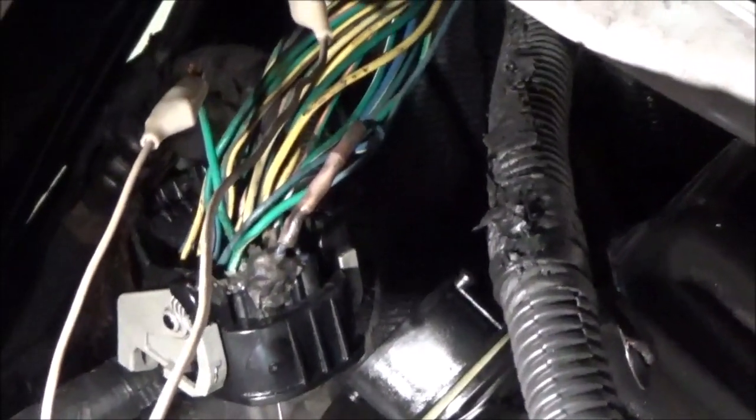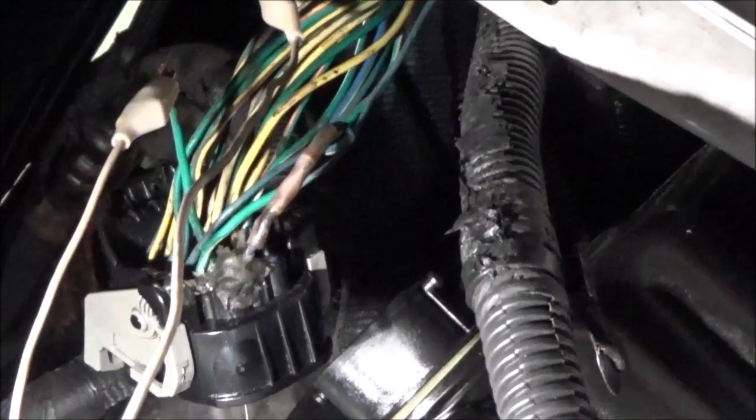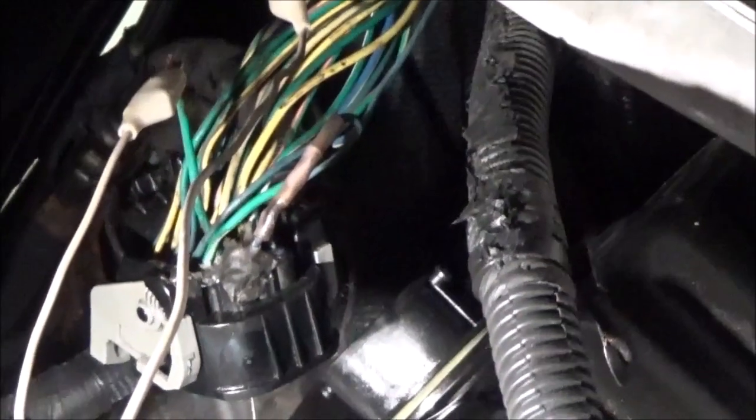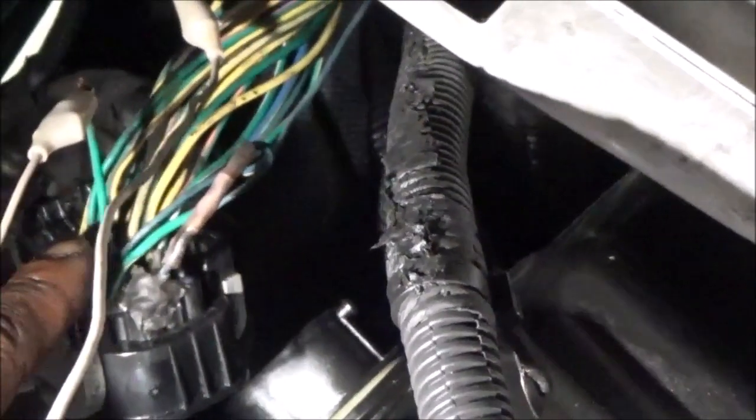Now, if I had changed this whole connector out with a different connector, I probably would have eliminated that. So now these have some more wires that are broken on the inside of this connector that have to be repaired. Just wanted to show you that. Even though the 2-4 was fixed, now I'm going to have to go and take this one out. And there's another wire up here I don't like — a blue one — that might be a problem.